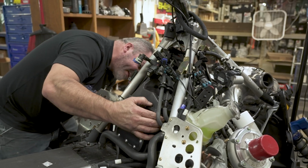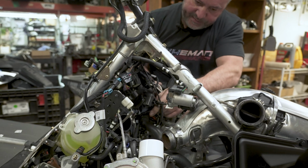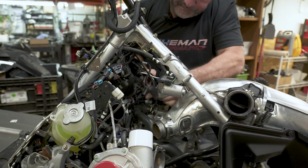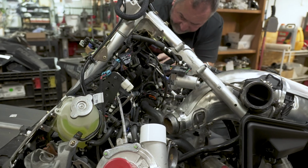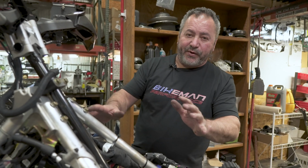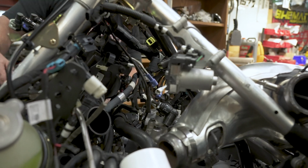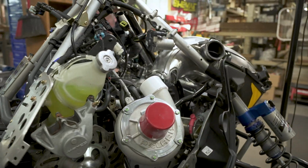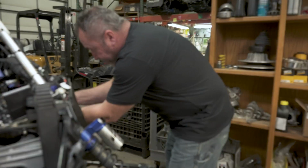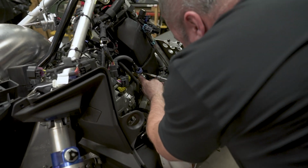All right, before you go ahead and seat it back into the boots, just kind of rearrange all your wires. After you get your airbox in place, your wires sort of where they were, go ahead and start clipping them together and putting them back on the clips here. And then I go ahead and push the box on all the way, and I will tighten up the clamps. And again, too tight is too much, it's just a clamp. Just make sure it's centered, make sure you're pushed all the way on, and snug it up.